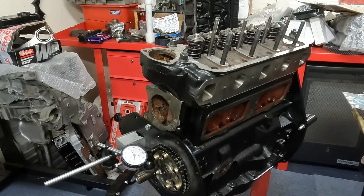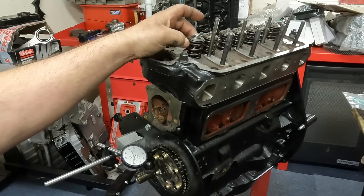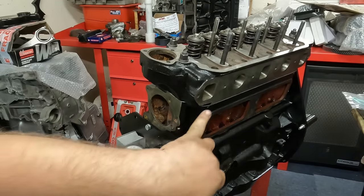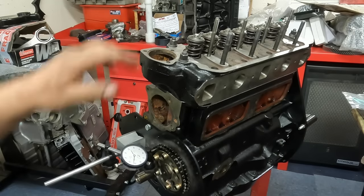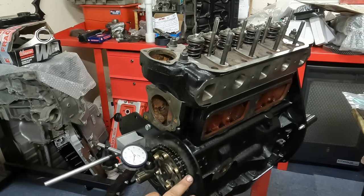So I'm getting close to the end of the MGB engine. I've got the cylinder head bolted on. I've set the valve springs installed correctly, ground all the valves in, vac tested it. It's all gas flowed as well. I've cleaned all the studs up, so the next job I'm going to do is set up the vernier timing